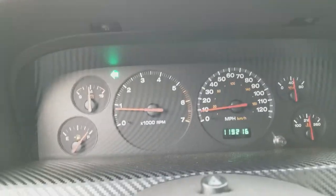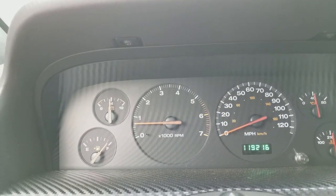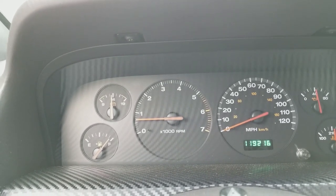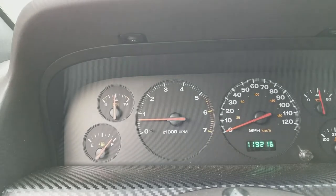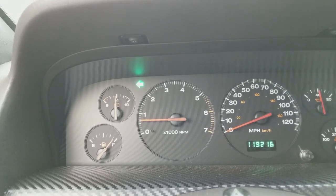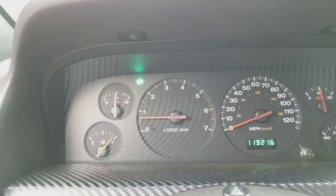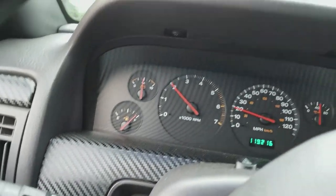I'm going to end the video here. You see, if you push the cable towards the throttle body, it actually makes it hold the shift longer — so that's a correction. If you pull it away, it'll make the shifts a lot shorter. For instance, my cable was pulled out further, so it shifted at 35 instead of 40. If it doesn't make sense, just leave a comment and I'll definitely try and help you guys with that as much as I can.